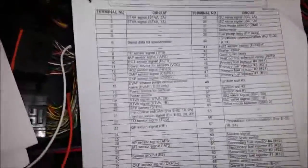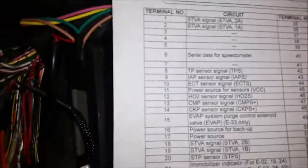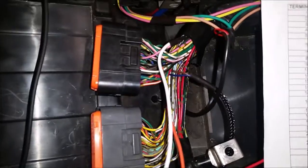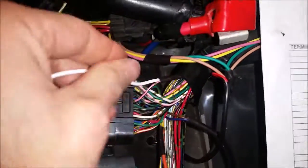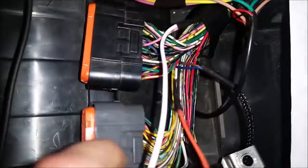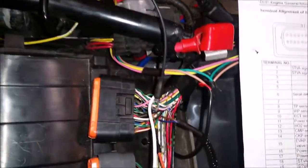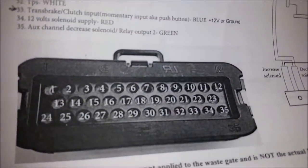There are a couple of things — luckily it says exactly what it is. I ended up connecting the orange and white wire into my harness, soldered on and shrink wrapped with marine glued shrink wrap. There's a black one for ground over here, and he labels it all by number which makes it somewhat easy.